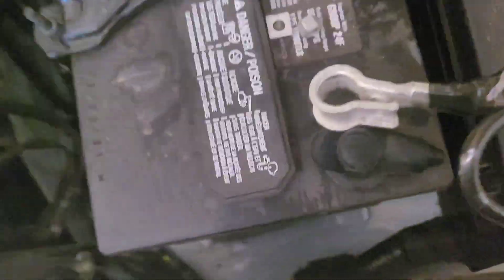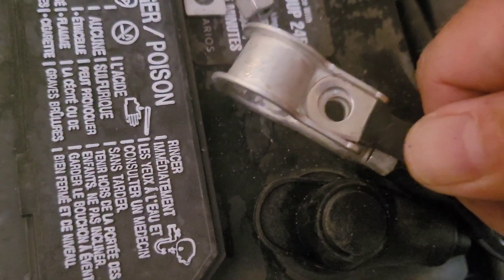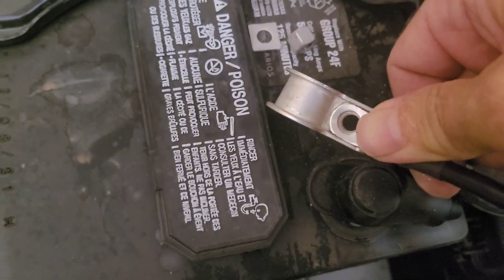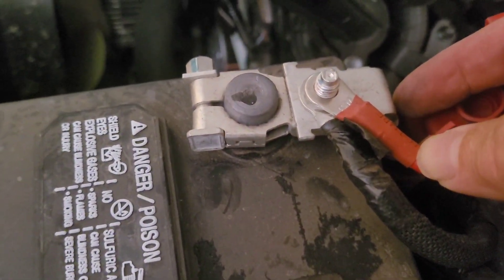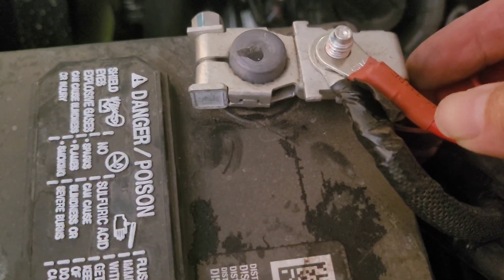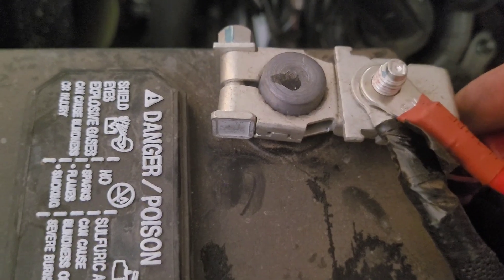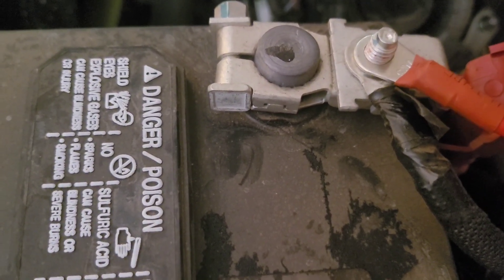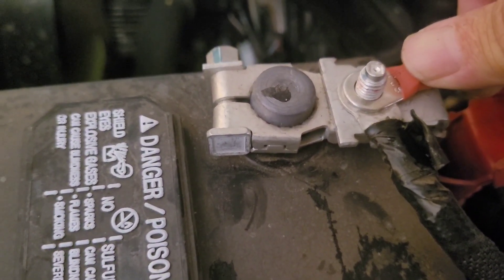So I'm filing this thing down. Okay, that's going to fit in there now — just took a little bit off the sides and we'll put it in with the retainer bolt. The positive side we can go directly down onto the other retainer bolt. Electricity on these doesn't flow through the bolt itself — it flows via surface contact on the bottom side, so the lug needs to be flat against the terminal.